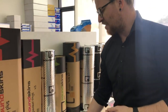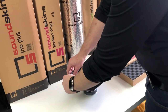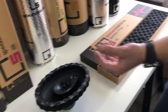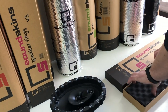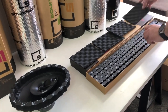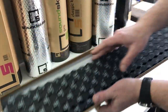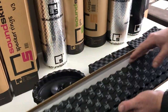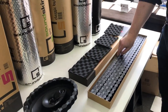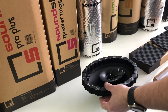That would allow you to get the most sound into the cabin for your listening pleasure — just improving that sound a fraction more. It's what all professionals and manufacturers have been doing for years. Whether you're using $50 or $1,000 speakers, you really should be doing this so you don't lose any of that sound. Now we're including foam strips — you'll get six strips, 27 inches or 70 centimeters long, to go around the face of the speaker to build it out and seal it against your door.